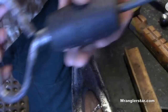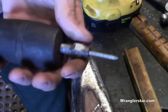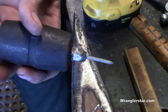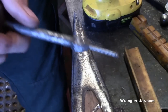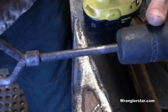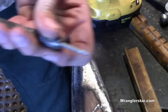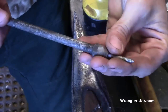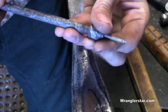This tool here is an old auto body slide hammer. Back in the day, you would thread a small machine screw in, drill a hole into a fender with a dent, and use this to pull the dents out. These work great for all sorts of things. You can make one yourself — it's pretty simple with a piece of heavy wire, a heavy weight, and some way to attach a screw. This is a really good design because as the screw wears out and you pull the threads off it, you can simply reinsert a new one. A simple, great design.